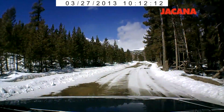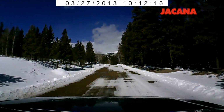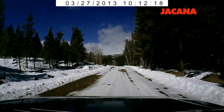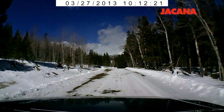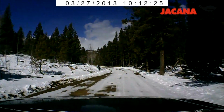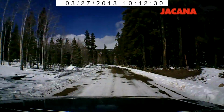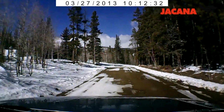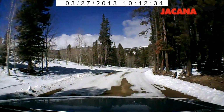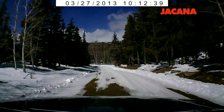People, when they go snow wheeling, there's a gentleman who actually lowers his tire pressure down to 5 psi. Now, I think you probably have to have special tires in order to do that. A regular tire in a family sedan lowered to 5 psi, you're probably going to mess your tire up, just because the tire is not going to be able to support the vehicle. These off-roading tires have very strong sidewalls, etc.